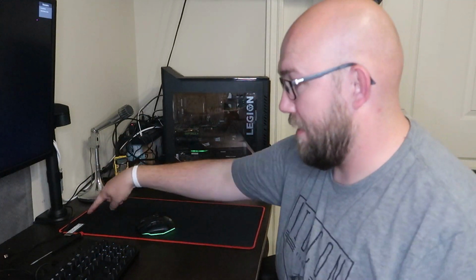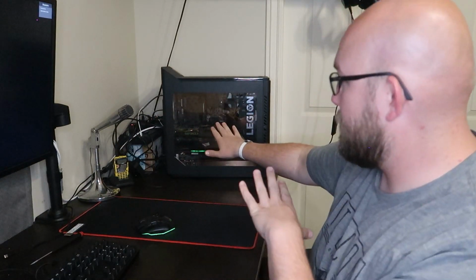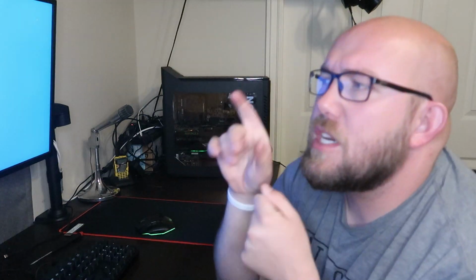Alright, we got it all back together. We've got the small drive pulled out, we got the big drive in there. Moment of truth. Ooh, they're gonna restart for me. So it looks like it didn't automatically pull from the place we wanted to boot. It's gonna restart. I wonder if it's gonna be smart enough to pull from the other one. If not, we just gotta hit F12 until it gets to the boot menu. Let's see what happens this time though.